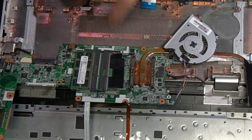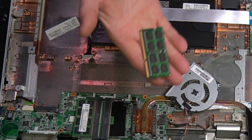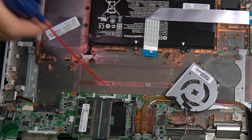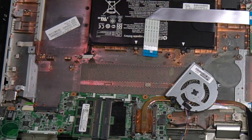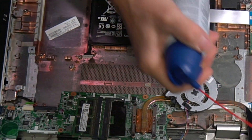This is where you insert the DDR3 RAM chip set. It goes in one way with the small side on one and the large side on the other, with the chips facing up. Go ahead and blow off the motherboard with some compressed air to get a good clean connection before you insert it if you like. I went ahead and cleaned up the rest of the computer board and the heat sinks and the fan with the compressed air while I had everything opened up — it's just a good time to do a little bit of preventative maintenance.